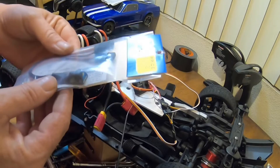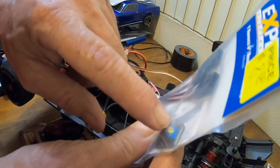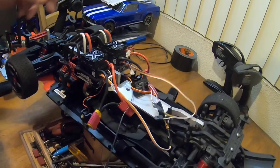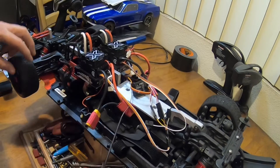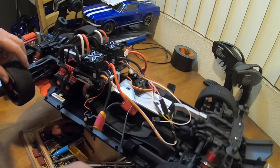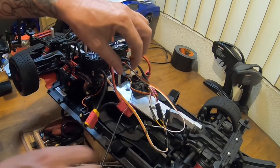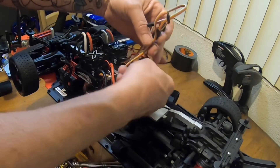It's like a poor man's BEC — you control it by turning it to send power out to your fans. If you have a high-output steering servo you can kick up the voltage to everything and then just dial it back with this. That's where I'm at.